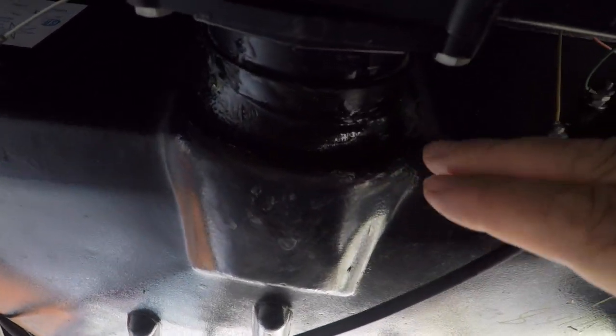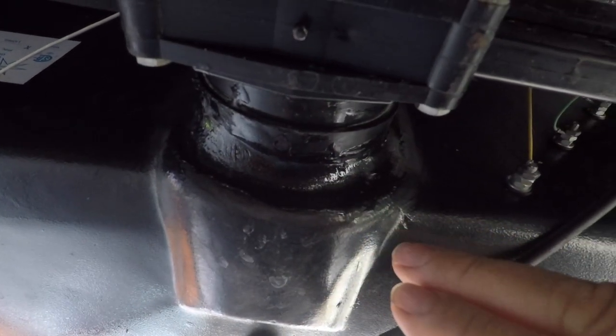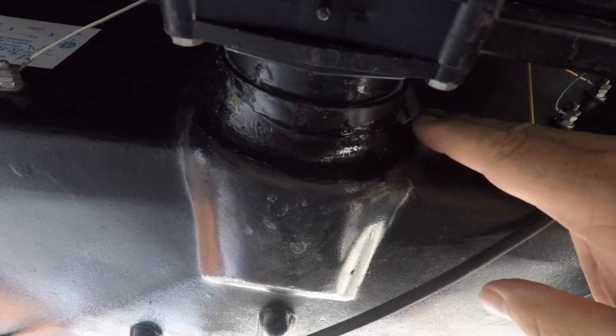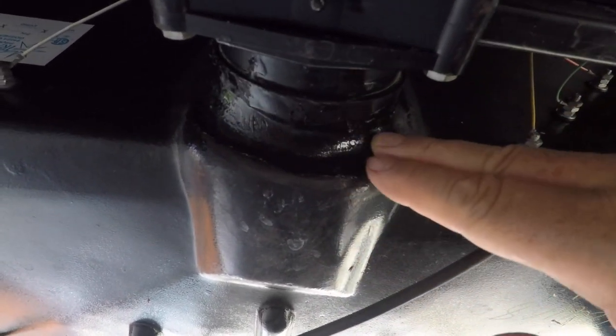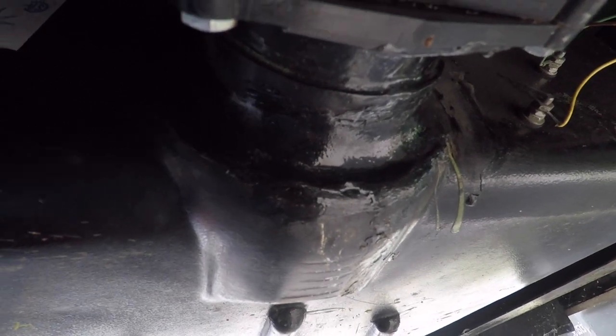I used a product called Fairing Repair — there's a good video on YouTube about it. It's a direct-apply ABS product that ABS-welds right to the tank and makes a really nice repair. I used it everywhere I had a problem; both tanks had cracking and it did a really nice repair job. However, some individuals reported it had cracked again just a year later — and that makes sense if you haven't solved the underlying problem.